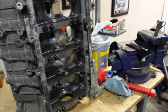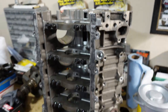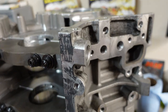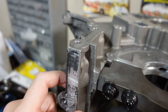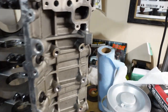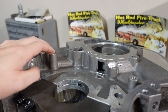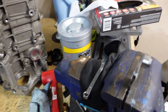A lot of guys say these WAP blocks won't handle 700 horsepower, but we were able to make about 1,300 at the flywheel — probably around 1,100 at the wheels — enough to go fives in the eighth mile at about 3,200 pounds. A couple of my secrets to make these things stay alive: I deburr all the edges I can on these cast aluminum blocks to prevent stress risers. I also port the oil pump holes for better oil flow, and these blocks get upgraded timing pins — the factory ones aren't strong enough for two-steps and rev limiters.